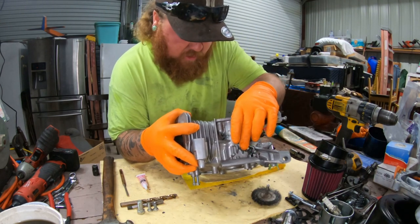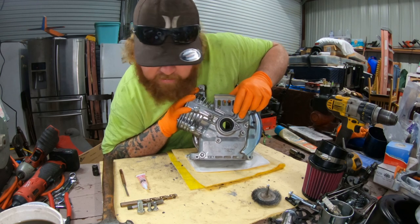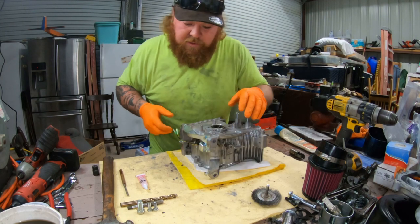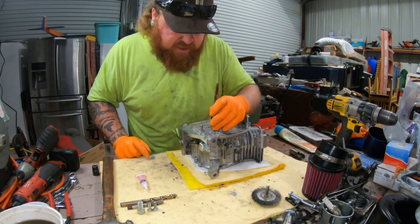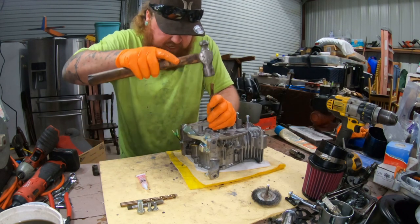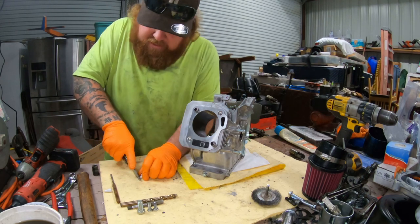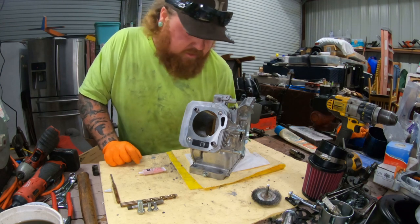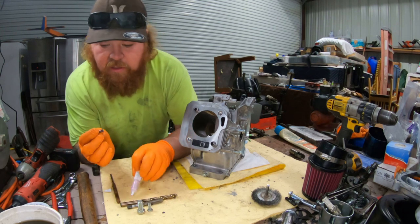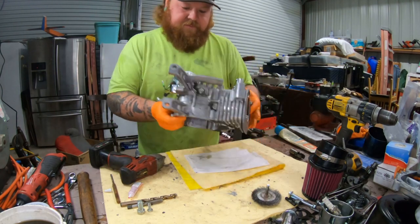Case time. On the top here there's this one where the governor arm went through, and there's this dowel pin right here that the gear for the governor rode on. I'm going to knock this out real quick. From what I've read you can just put a bolt on it, zap it in, and you don't have to tap it. The only one you have to tap is for your oil sensor. I've got a little punch - see if it'll pop right out or if it's staying. One, two, three. And there's the pin that held your gear on. Using red Loctite because it ain't ever getting that pin again. If you're this far into it there's no warranty either.